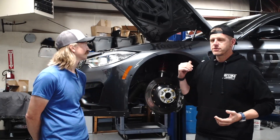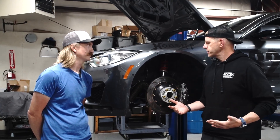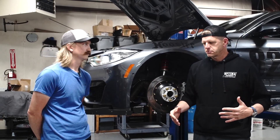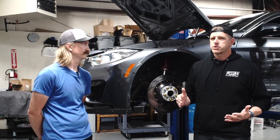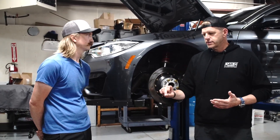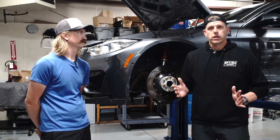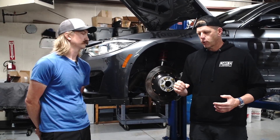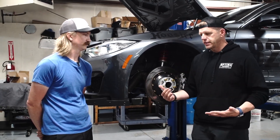James and Phil at Bimmerworld, and behind us is our GT Moore project car. One of the first things that really started this project was suspension. We've been running these GT4 cars with just these massive tires — a 305 slick, which is pretty big and huge to stuff under the front of one of these cars. There's no way in the world you get that size tire reasonably on a stock car and make it work like a race tire — give yourself the camber adjustment, all the adjustments you need to actually make that tire work like it should to optimize performance. So the project kind of started with: how are we going to fit these tires on the car?